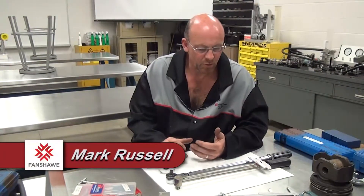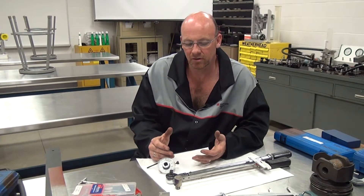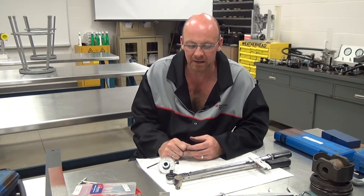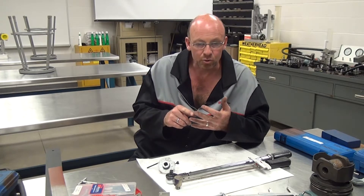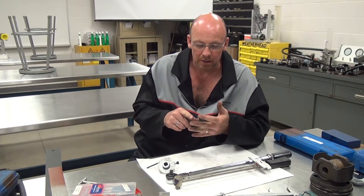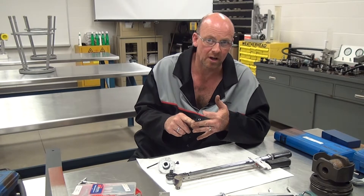Looking at some other tools — of great importance and sometimes overlooked. I've seen technicians over the years put things together just with impact guns and say, 'that's tight because I know my impact gun.' You can't really determine torque from an impact gun because things change: the gun wears, the tool configuration changes the actual torque, and the air volume may differ from shop to shop because the air compressor is on or it's not on.